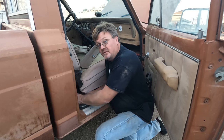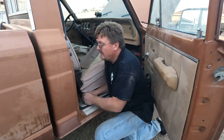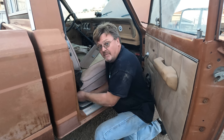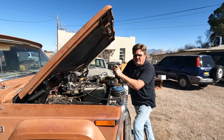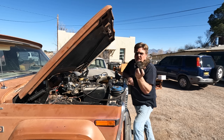I figure it's time to actually bolt the seat down. Last time I drove it I just threw the seat in with nothing attaching it — it didn't really matter because I couldn't stop anyway. But now I might actually use the pedal, in which case I probably want something to push against. I also noticed that foamy dirt-rust stuff coming out of the radiator, so I went ahead and flushed it. It took about six or seven times running water through before it came out clean. Then it came out the water pump also — so it's time to change the water pump.